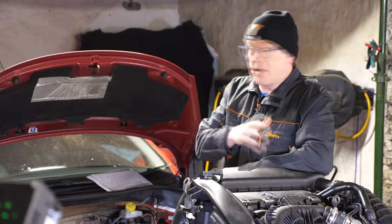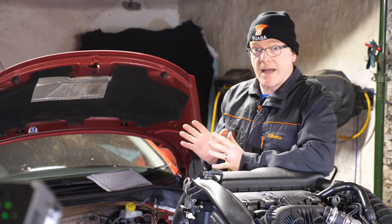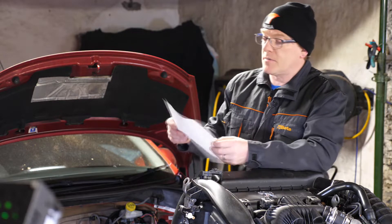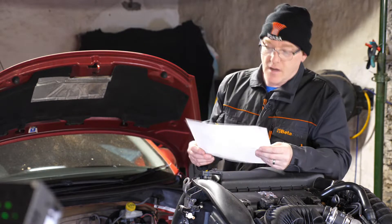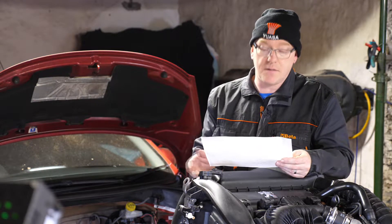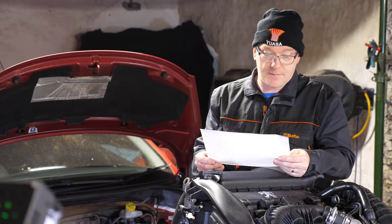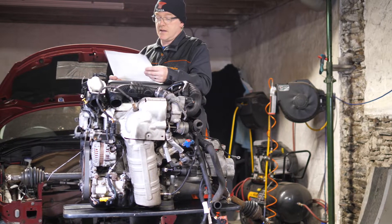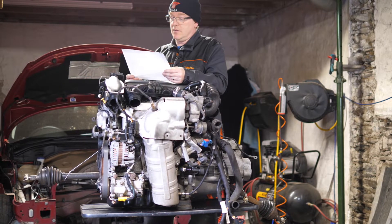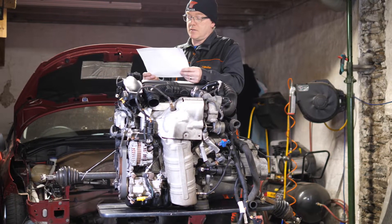The engine was working — it drove out of the garage and I turned it off — but then the problem happened the next day. I've written it all down so I get this correct as it happened last year. I went to start the car and it seemed lumpy, as if firing on three cylinders. There was also a plastic banging sound when revved. I turned it off and after a few minutes tried to start it again — it sounded like the starter motor was spinning on its own.